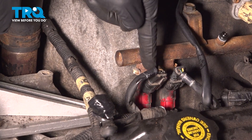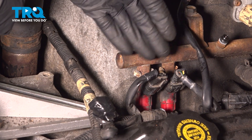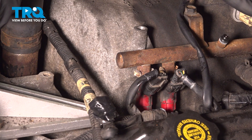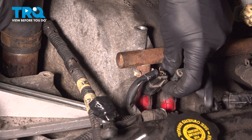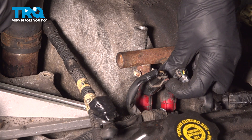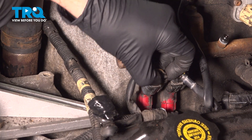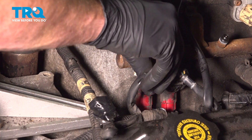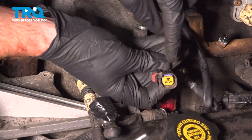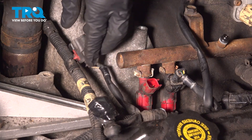I'm going to be replacing this fuel injector right here. Commonly, people will be replacing all of the fuel injectors at the same time. If that's the case, you want to make sure that you pop all of the electrical harnesses off of each one of the fuel injectors. In our instance, I'm replacing this one, so I'll reach down in here. There's a small red locking tab that you can grab onto and lift it up. Once you've done that, continue on to squeezing on the little locking tab here, and we should be able to pull this up and out. Give it a quick check for corrosion.